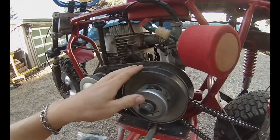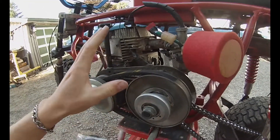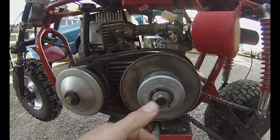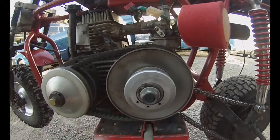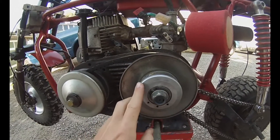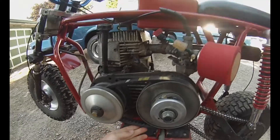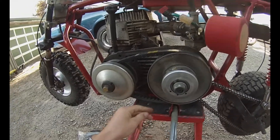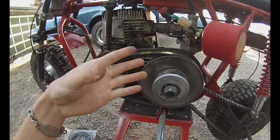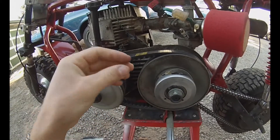So that is the way to get more power — move the spring to the farthest back hole when they're on the bottom. Just take the nut off and disassemble it on a bench. Be aware that the spring has quite a bit of tension, so hold on to it when you take it off, but it's not too dangerous. The only drawback is that it takes longer to progress through the gear range because it needs a lot more centrifugal force to overcome the spring and move up into the higher ratio.